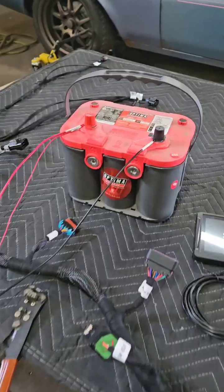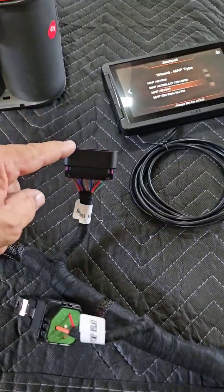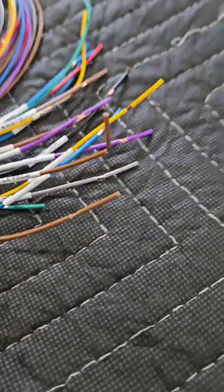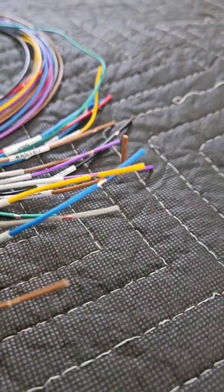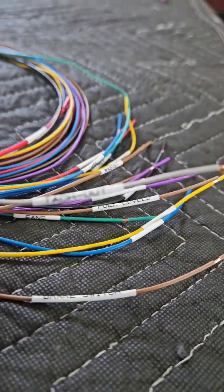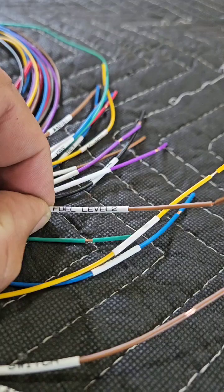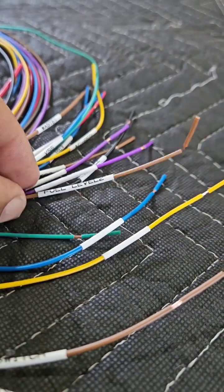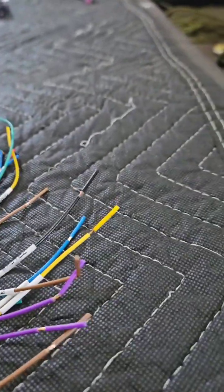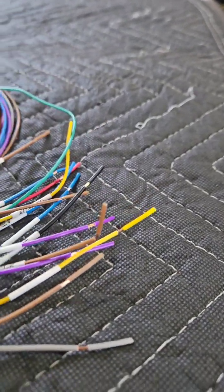Three wires to run it, one extra wire to run your fuel pump. Then you have the additional wire harness, like I showed you — it just plugs in. On the additional wire harness you have your brake switch — I don't need that one, that's usually for your transmission stuff. The only one I use on mine is tach out, so I can use my Stewart Warner aftermarket tach. But you have fans in here, fuel level — I did talk to them about that, it's not operational yet. Vehicle speed controls, step retard — all kinds of cool stuff.